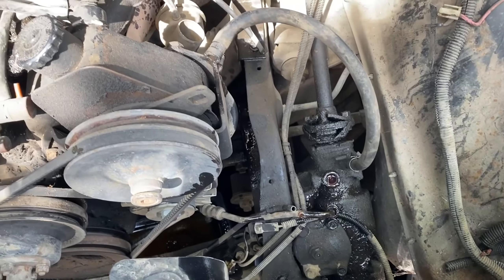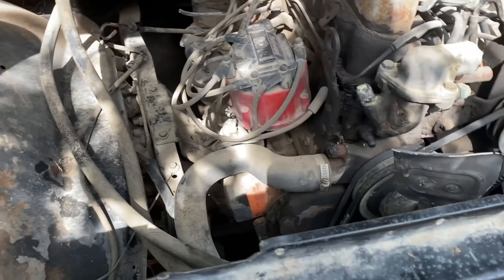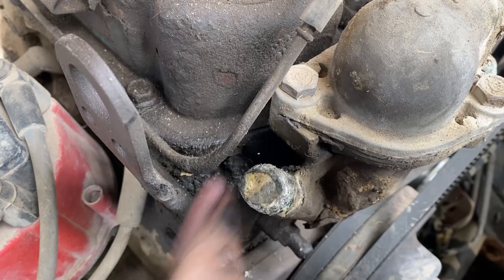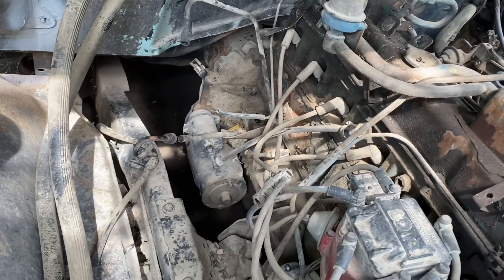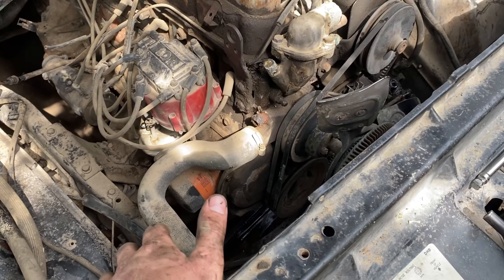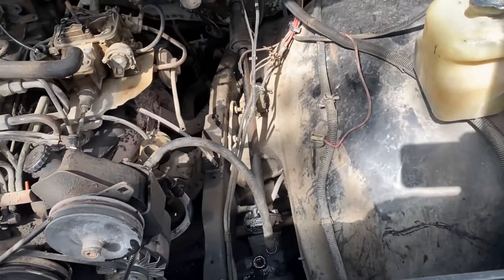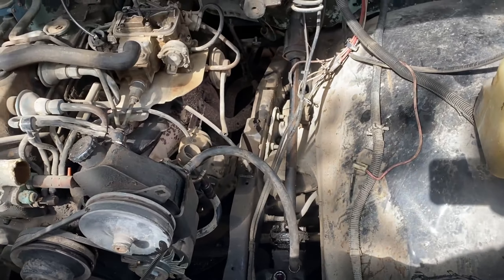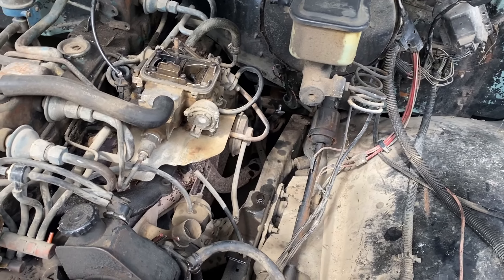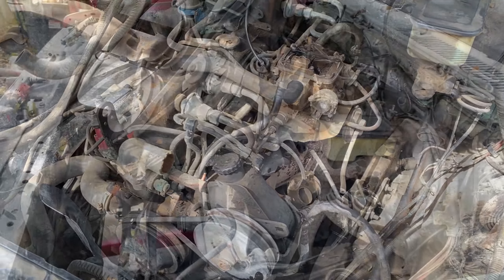Here's where I'm at so far. I've got the stock harness pulled off, laying right here. Power steering lines are off, fuel hose disconnected, got the radiator out, and disconnected the heater hoses. This is why my heater didn't work — one of the heater hoses. Done did the starter harness and all that — it was part of the main harness. All that's really left with the engine is to pull the motor mount bolts, undo the transmission cross-member bolt, probably pull the cross-member itself, pull the drive shaft. I already undid the shifter.